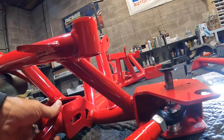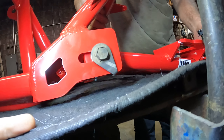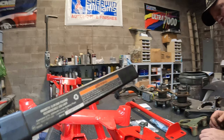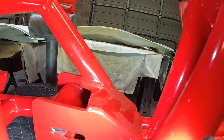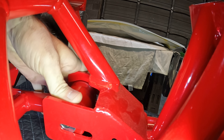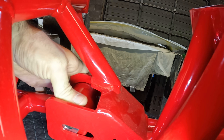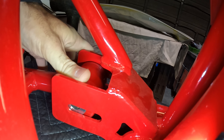With this thing fully assembled in place, we get over here and get our hardware put through the hole on this side, but we can't get that bolt through on the other side. We could probably force it, but it's not going to be fun to force and it's going to cause premature bushing wear.